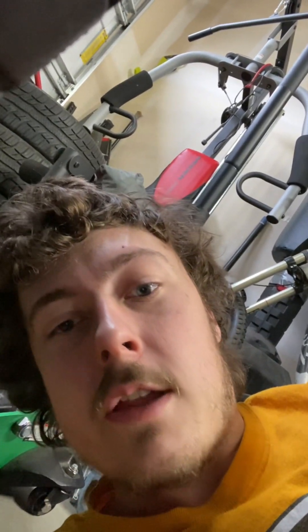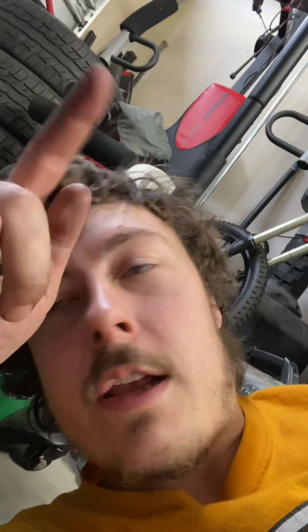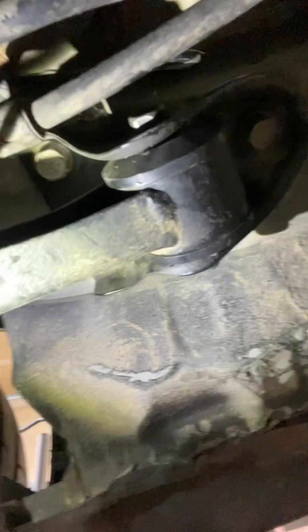I already got her back on and squeezed these guys on as you'll see in those clips. I didn't do it the exact way you should — you should wire brush it. If you have a drill, put a wire brush on there and brush it. I didn't get all the rust, I got most of it, but I'll be replacing these hubs with STI ones soon. When you go to put it back on, install these bolts, try to line up where the previous marks were, get that tight, then secure the bolt on this side. I'd actually suggest getting that bolt in first, then lining up the rest of the trailing arm. Per the Subaru manual, tighten these bolts and then put all the pressure onto this guy before you tighten that up.